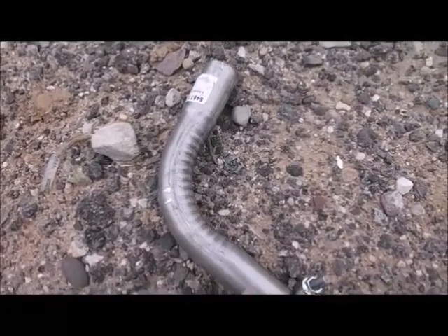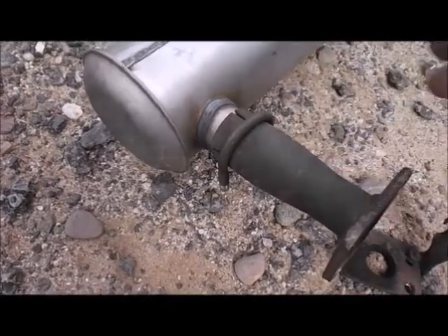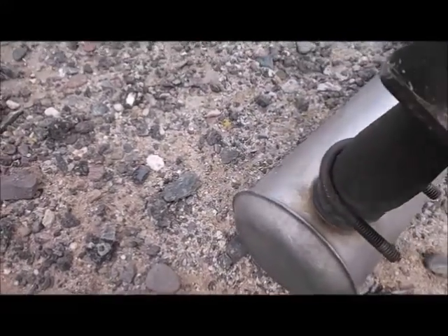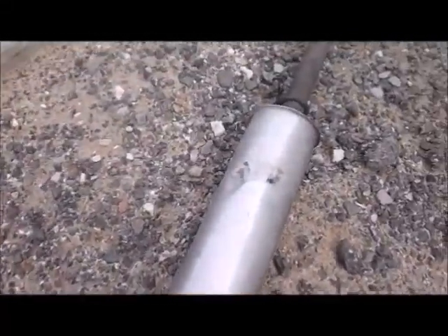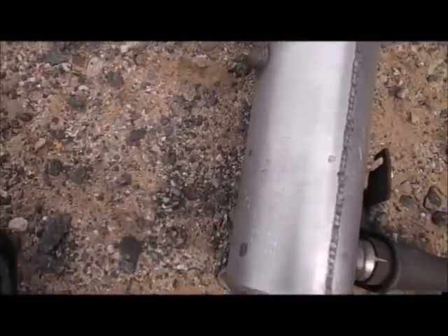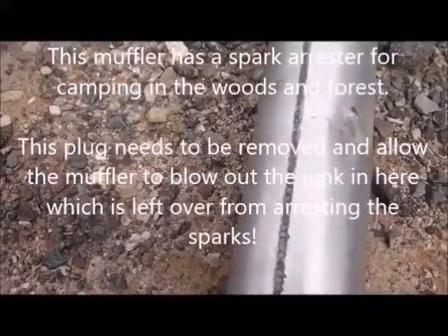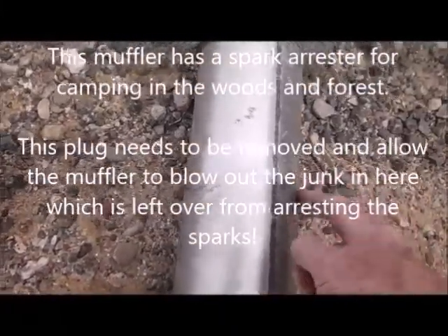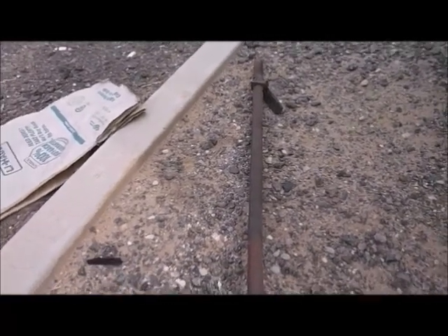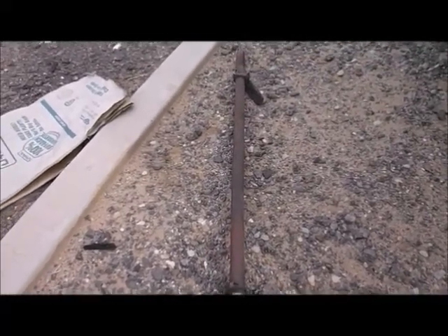I need to make some kind of modification for this elbow — I might just cut it so it goes over the top somehow. This is what was in there before, and as you can see the muffler is damaged right there. What happens is it either bottoms out, or this time it got hit and pushed the muffler up into the frame. That's the rest of the exhaust pipe with the hanger that went out the back. I'll put it all together and do a follow-up video.